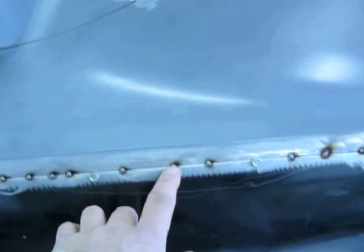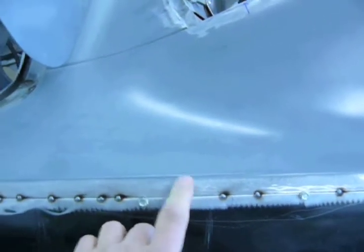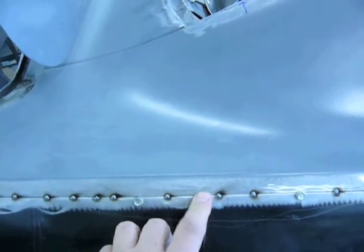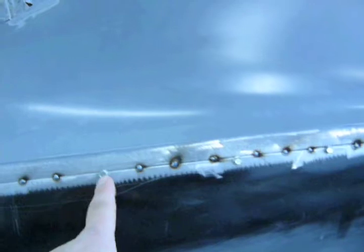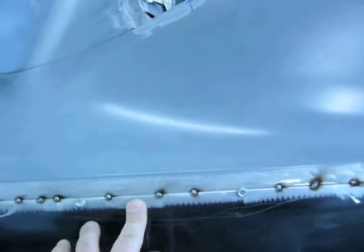And now, there's really nowhere else to push in with the screwdriver. So now I'm going to do hot tack. Hot tack is basically a tack like this, but in succession, like 2 to 3 tacks, like tack, tack, tack, tack, all on top of each other while the tack is red. So better penetration and it'll get the job done faster. But I had to do these ones so I could use a screwdriver to get the panel flush. Because if the panel's not flush and I start hot tacking, I'm going to be burning.